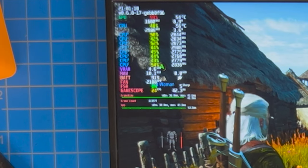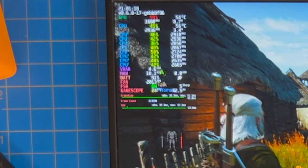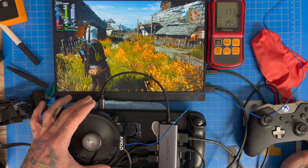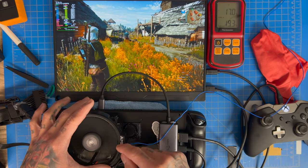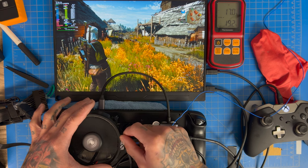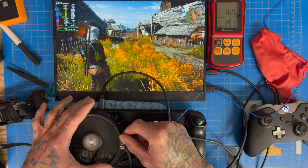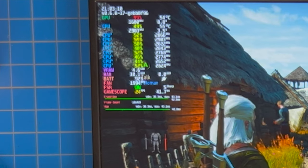We're at 55-57°C now. Contact with the heat shield looks solid. Room temp probe (channel 1) dipped when we moved it away from the heat output. We're approaching 49°C — can we hit 49? This peltier reached -5°C in direct bench testing, so on the Steam Deck I'd estimate we might hit around 14-15°C at the probe. Fan speed has dropped to 2,000 RPM — then 1,900 RPM. I've never seen it this low outside of cold boot.